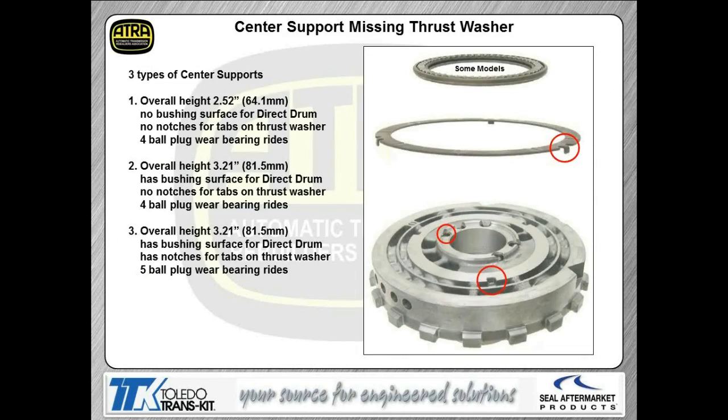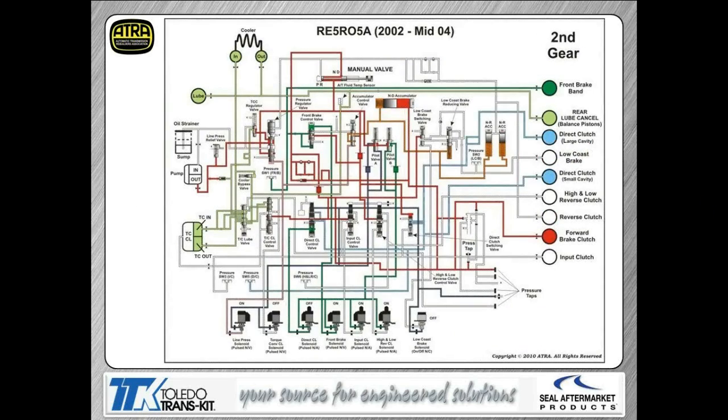So you have to use a watch if you're going to do this procedure, because as you can see here, they want you to turn the ignition on, wait 2 seconds, turn it back off, wait 10 seconds, and then do the same procedure again. Now, obviously, if we don't do it within the right amount of time, the adaptive strategies won't be reset.